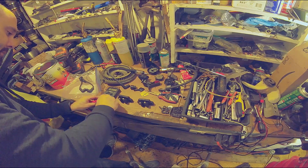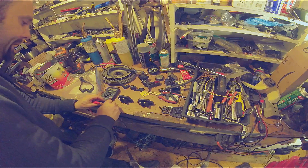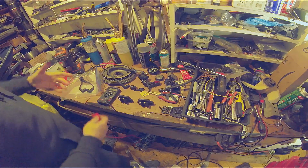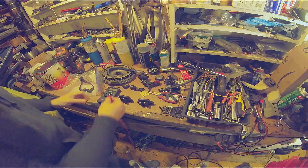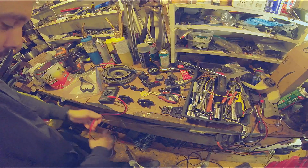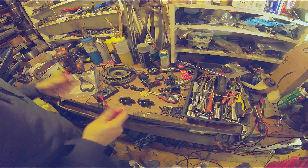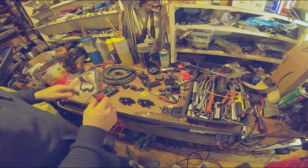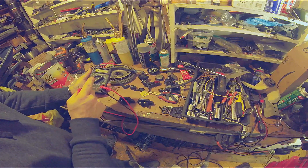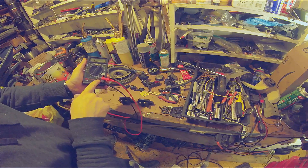I couldn't get a freaking answer as to what setting to use to test these coils. The one video that comes up every time I search has a meter that's not digital, and I don't know what it reads or what it's supposed to say. I'm sick of watching that video — it didn't answer my question the first time, didn't answer it the 30th time. The channel's good, the guy's hysterical, does great work — it's just not answering my question. Anyway, the setting I used is 2000 OHM.